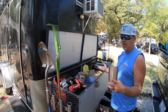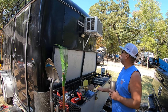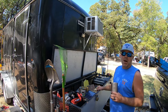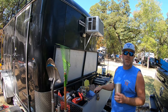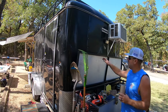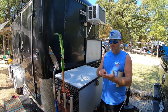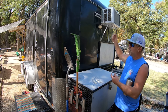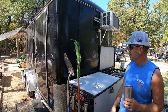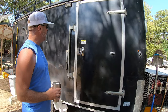The whole system runs on either 120 or 12 volts — some stuff is 120, but everything's 12 volts where we can. Window AC is stabbed into the side or the front — I would probably not do that in the front again. It catches a lot of bugs going down the road and moisture can get in when it rains, but you can hang meat in there on the beach at 100 degrees. The good thing about a window AC versus a rooftop is if it goes down, you can pull into any Walmart, Home Depot, or Lowe's and for 200 bucks grab another one — way more efficient than a rooftop install that runs a grand. We also have 120V exterior power outlets on all four corners.